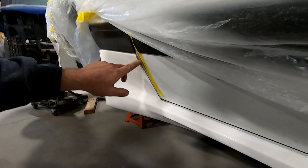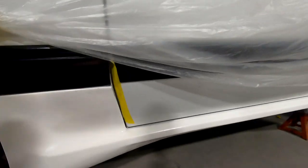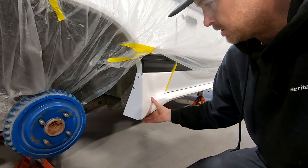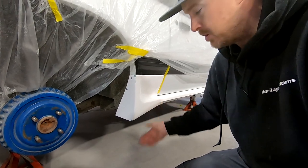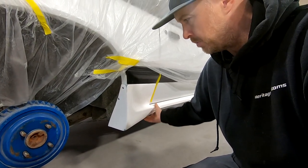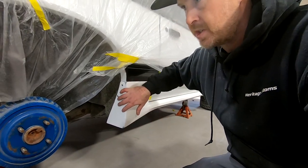Same thing back here — I did a little bit of trimming right here just to make sure that this is nice and smooth with the edge. You still need to do just a little bit of light sanding there. On the back side of the side skirt, both these holes are drilled, which gives extra rigidity. Nothing needs to be done on the underside here. It was kind of a toss-up — do I put an extra hole in here or just use one screw and find ways of fastening from the bottom? I opted for this because it avoids having to drill or come up with any weird brackets that might be needed on the underside. This was the easier route and still going to look super nice and clean when the hardware is all painted up.